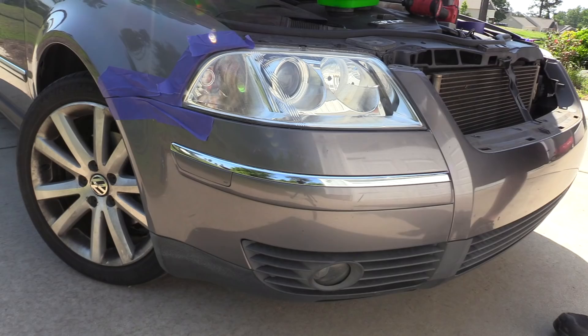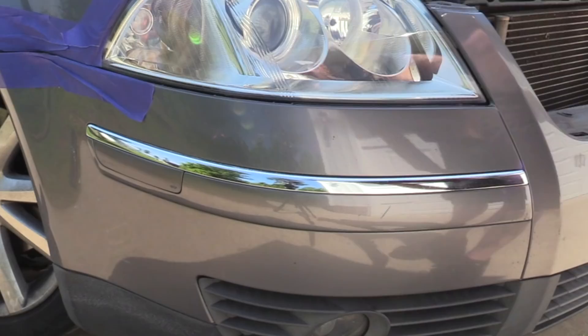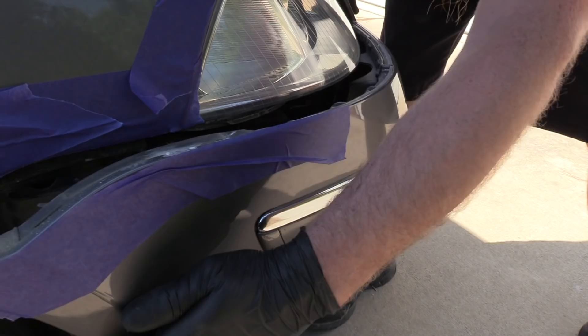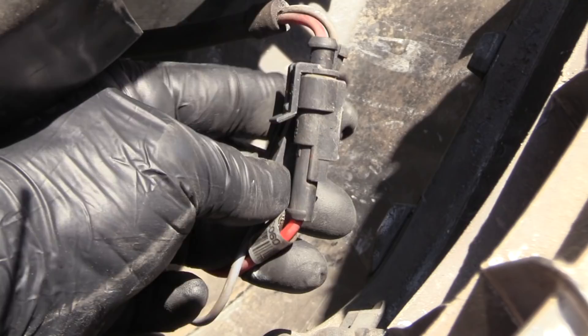All the fasteners are out — you can see that it's pretty loose. But before we go yanking the bumper cover off, we need to make sure we disconnect the fog lights as well as the marker lights in the bumper. We're going to slide the bumper cover forward, pull it away a little bit, and then disconnect the marker light — usually you just have to pull it straight out. The fog light connector is located quite a bit lower than that. If you have factory fog lights, it's just one connector; in my case I have aftermarket ones, so there are two.